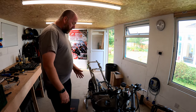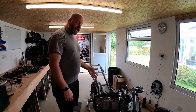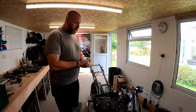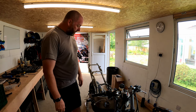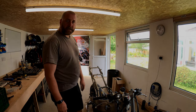What we're going to do now is pop the clutch cover off and the stator cover, and we're going to remove the clutch basket and the rotor for the stator flywheel because it's just going to be easier to do it while it's fitting in the frame with the chain on. So thanks for stopping by, let's get amongst it.